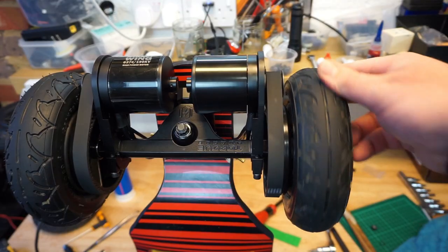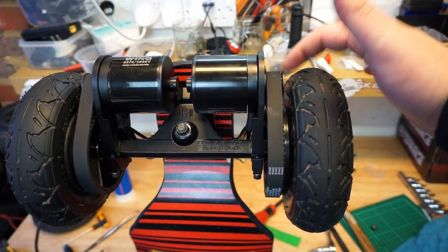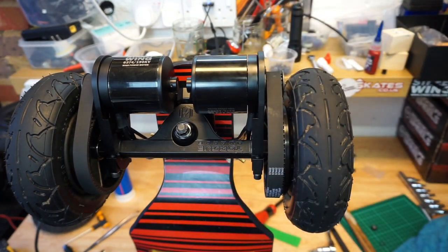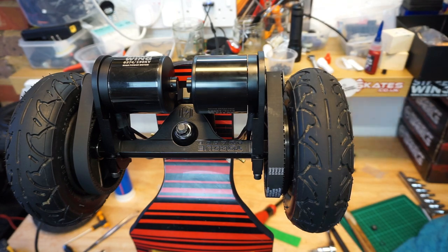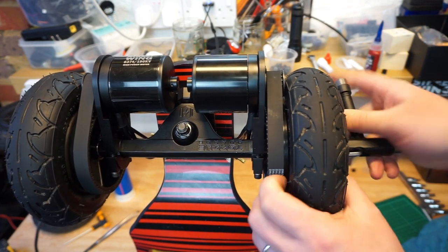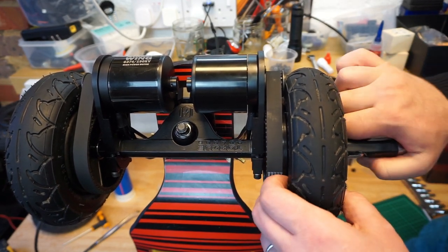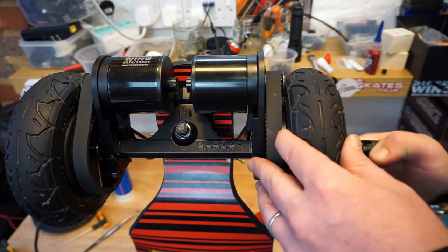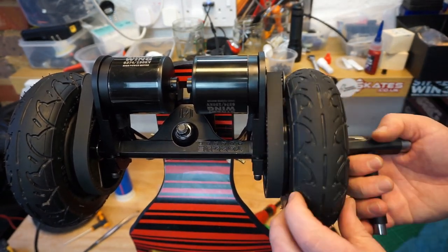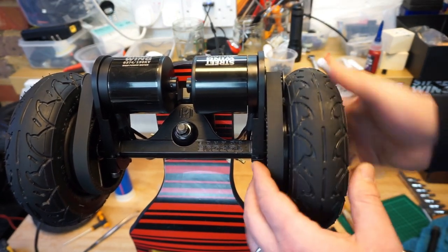And then you check. To be honest with you, I am happy with the way the belt is sitting. I am happy with the way the motor pulley is sitting. It's perfect. That's exactly what I want it to be. So now what I'm going to do is tighten up the wheel, make it all sit tight, check it again. I normally just tighten up the wheel as hard as it can go, because I was taking the bearings out and everything else, and I want to make sure everything sits in perfectly, so it cannot go any more. And then come back, let's say half, try spinning it a bit tight, loosen up again, try spinning it. If it's nice and free, perfect.